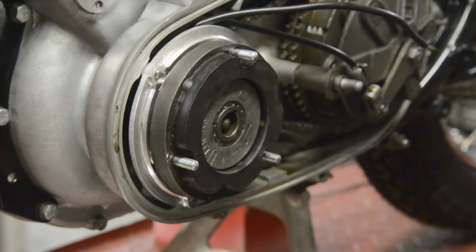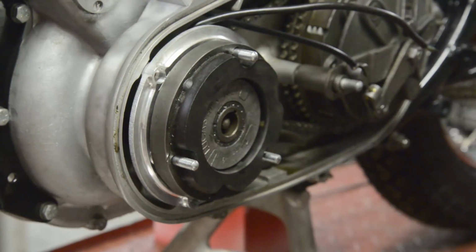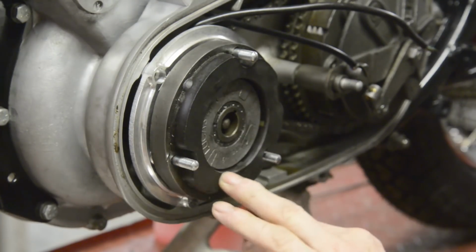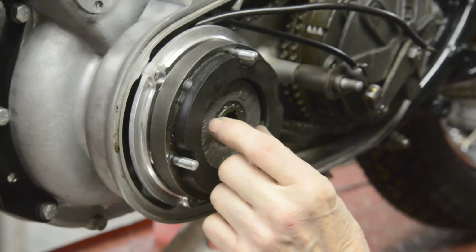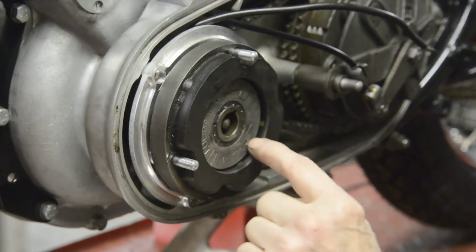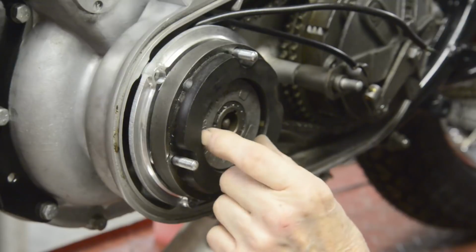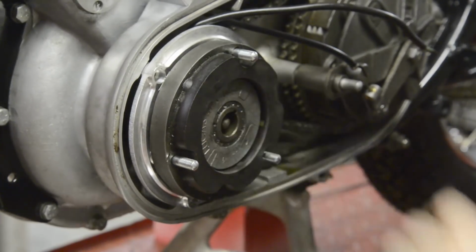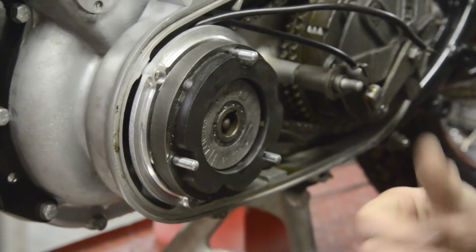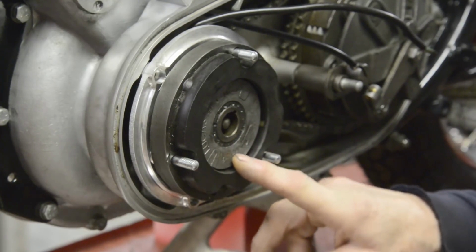One thing they did tell me which confused me was, he said, well, it depends on which alternator and all the rest of it, and I'm thinking to myself, well, I'm not an expert on these things, but I thought they were all the same size. I remember I did find out that the ET one was a slightly larger diameter rotor, because when I fitted a different rotor in the same stator, it was too much of a gap, you may remember, on that C15.